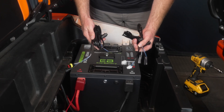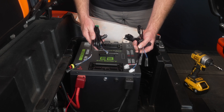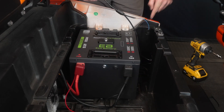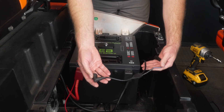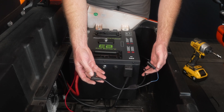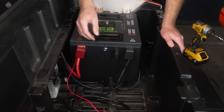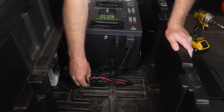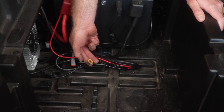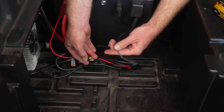Your kit would have come with one of two CAN communication cables. Depending on which cable you use will dictate how we do the installation under the dash. We have routed our CAN communication cable through the cart at the charge port down below and up towards the dash. The battery side of the cable needs to remain at the battery; the other side will be routed up towards the dash. We've tidied the cables up here and now need to connect the CAN connection from our charger cable.